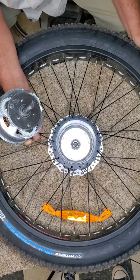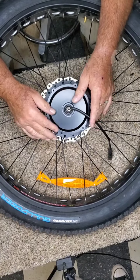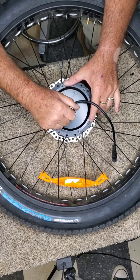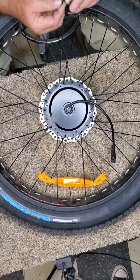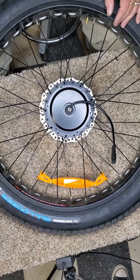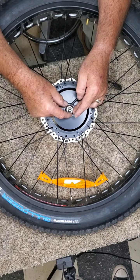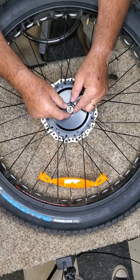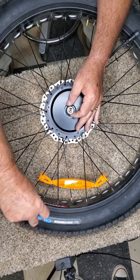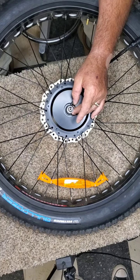Once you then remove the motor, you just put it back in there, you lift the hub. So now you can just align the motor to the holes on the hub, and you just tighten up the 6 nuts. Incidentally, when you go to put the wheel back on, we want to have the tab facing outward, on the washer, the large tab washer, and then we also want to have the tab pointing toward the wires coming off the motor. This is the fork, and so the slots face the ground, and then you have your fork, and then the outer washer, and then of course your bolt.